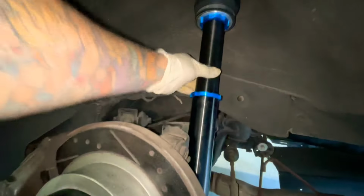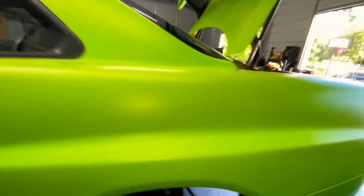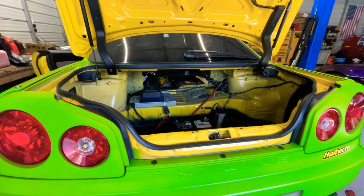All right, guys, so the last bag is in. You can see, there you go, last bag's in. Everything's tight. Make sure you guys tighten all these rings here and put the bolts up there on the strut. The line was ran just like the other one into the manifold. So we have all of our air struts in. Now I'm going to install the tank in the trunk and run the final line from the tank to the manifold. Get everything tightened up, check for leaks, and hopefully we'll be driving there soon.